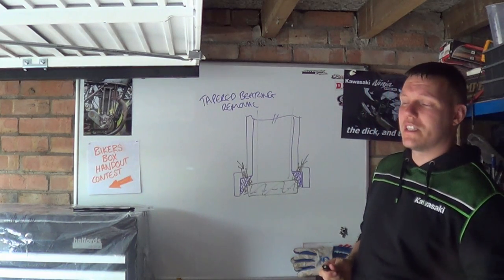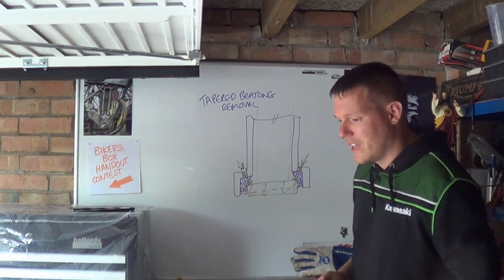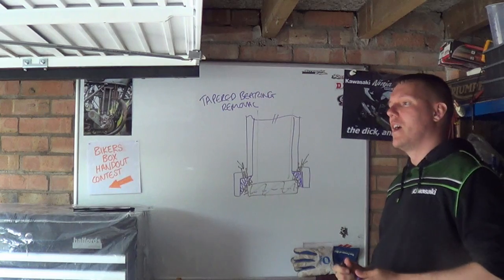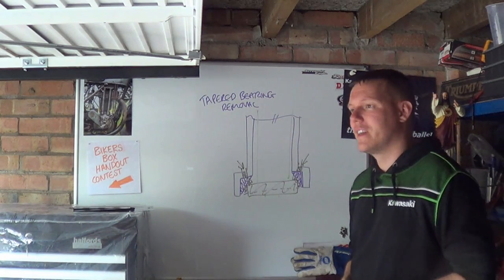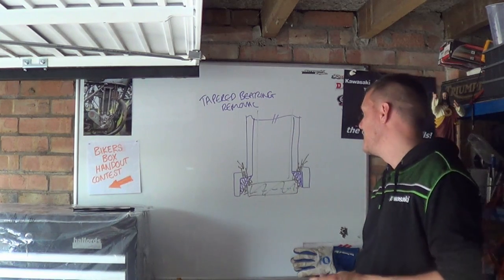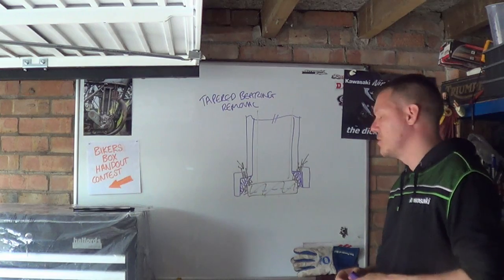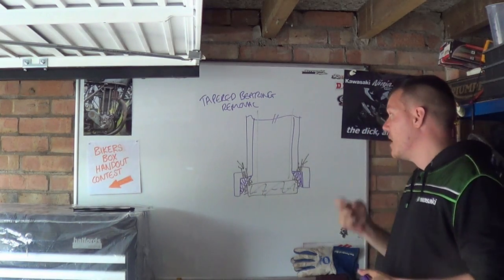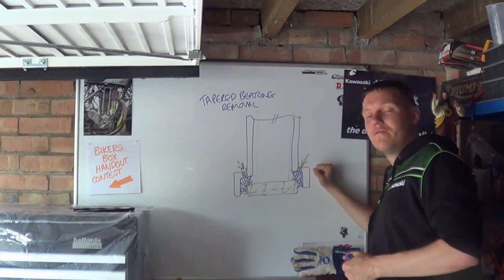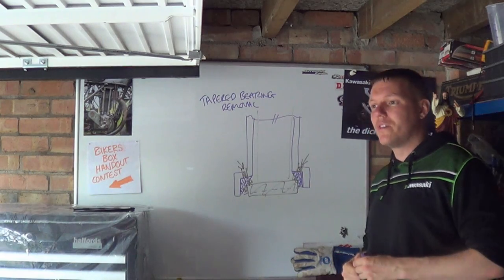And before anyone says, no, you don't make stainless steel races, stainless steel is quite a galling steel. It likes to gall and just mush up and all the rest of it. And hardened stainless steels really aren't that hard. So we make races out of hardened steel, tool steel, basically, pretty much. Hope that makes sense. Please, please, please don't drill it. If you can really avoid it, get someone just to stick a couple of blobs of tack weld on there.